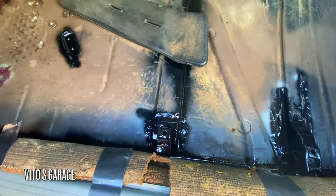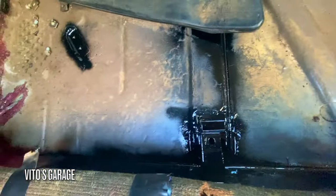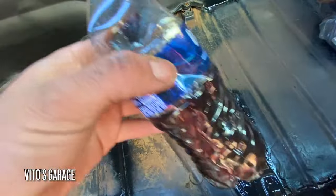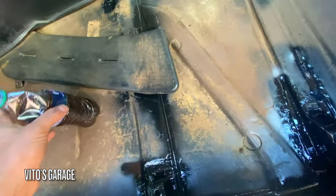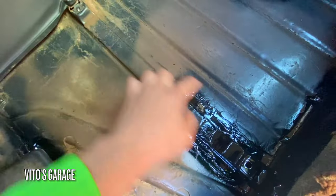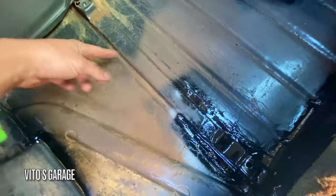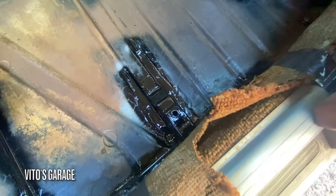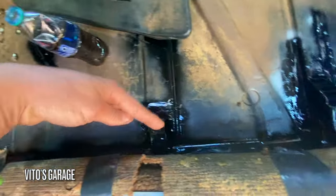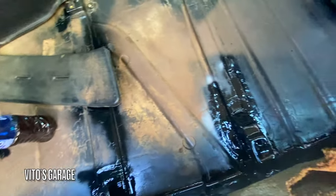This is still drying — I applied about three to four coats of paint, and once it's dry I'm going to put grease all over and fluid film as well. I'm also using used automatic transmission fluid inside this channel — the entire rail is spot-welded to the floor and you can't get to that side from underneath, so I'm going to pour oil through there so it can saturate everything and keep it preserved. After greasing everything up you can also pour oil everywhere and then put floor mats on top — it won't cause any damage.